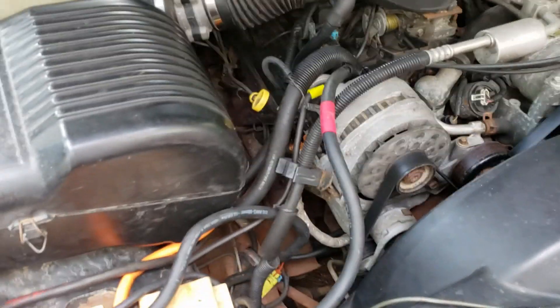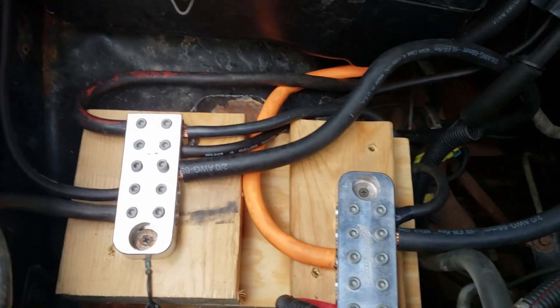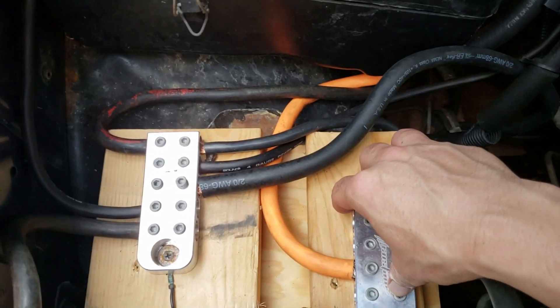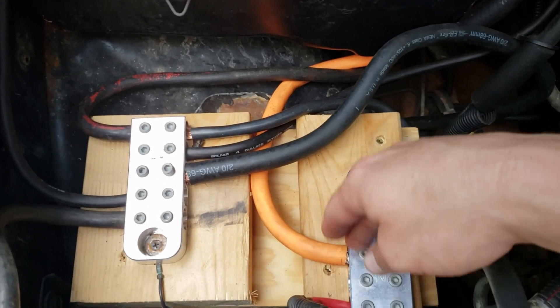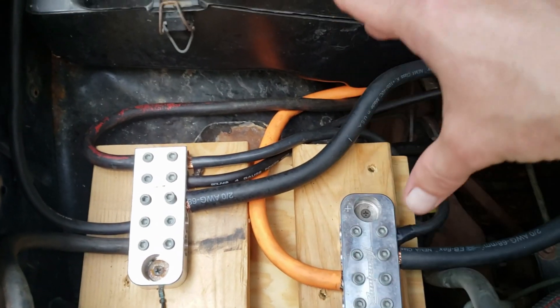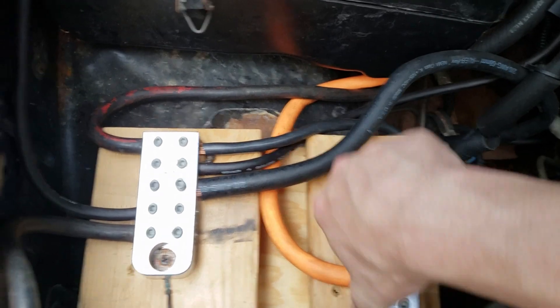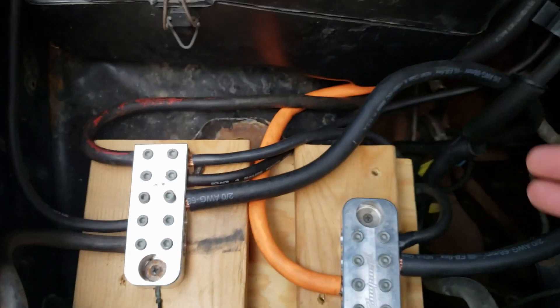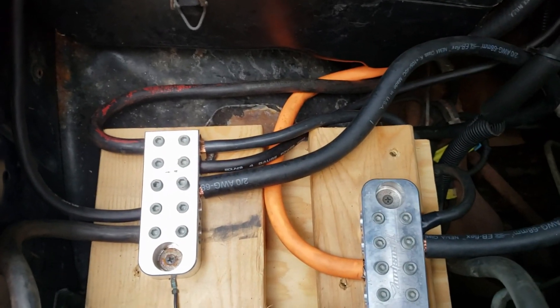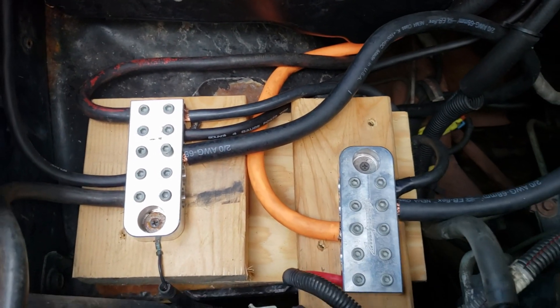I'm going to go ahead and show you guys what I've done. Under the hood, I have a couple blocks of scrap wood. I have some Ill Customs bolt-down terminals — these are 10-spot terminals, so I have more than enough to do all of my different wiring. You can get smaller blocks of these. They're just held down with a drywall screw and a washer, and they hold very nicely when tightened down well. You could brace these even better if you need to. I also have the big three and other common things you do on a bass head vehicle.